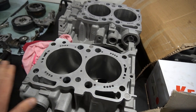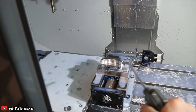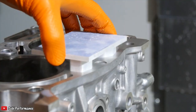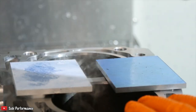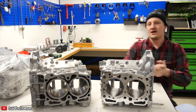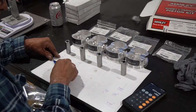The first step is having all of the machine work carried out on the motor. This is extremely precise work and must be done by people who actually know what they're doing — probably not us. This includes getting CNC billet inserts, cooling them down to below freezing so they shrink, and then tapping them into the EJ257 semi-closed deck block — this is the process of getting a closed deck block. Other work done included clearance for the 14mm head studs and crankcase dowel inserts down the main bearing journal. Once all of this is complete, the block is decked and comes out looking like a brand new engine. Subi Performance on YouTube is the channel to go to for more on this process.